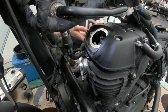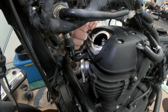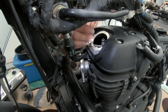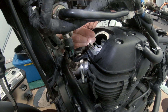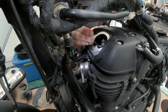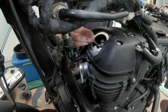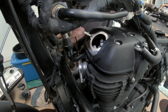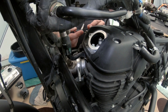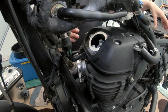What kind of butter on a semi-warm day? And 25 should get stuck. I don't want it to go through. 25. It does not like the 25. It says no, I do not want it. So, with that said, I would assume 24 would go through nicely. Not quite as nice as 23, more so as 25. I'm going to call it, it's a happy tappet.